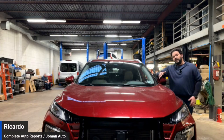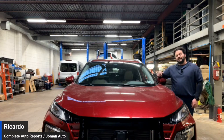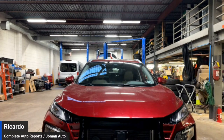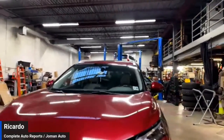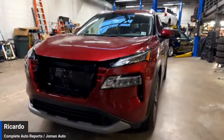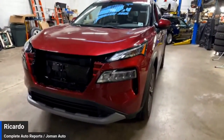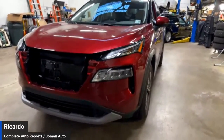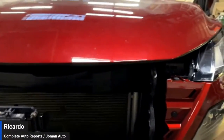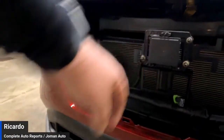In order to do that, we're going to review the Nissan instructions together and check off to see what the dealer may have done or not done. The first thing to note is that the grill is missing. The instructions state that you need to clean the area in front of the sensor — the actual grill — before you start.